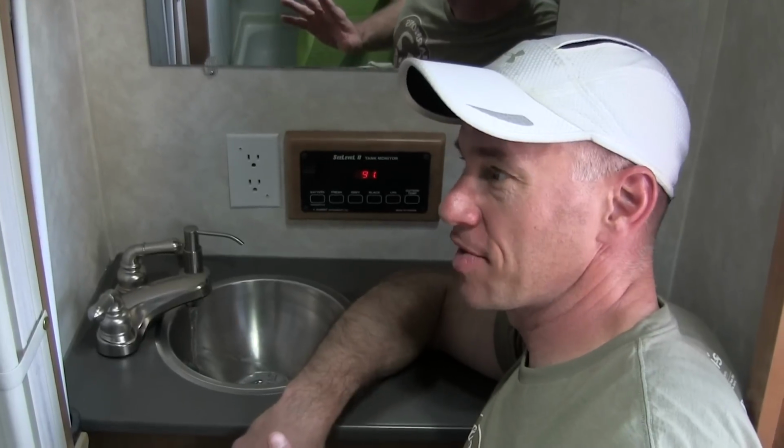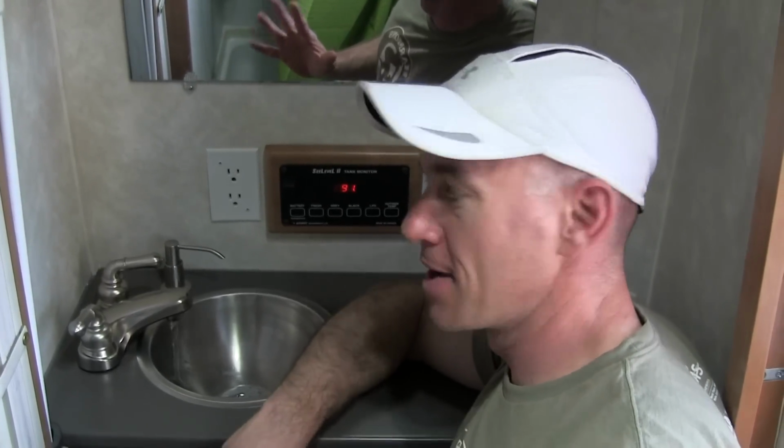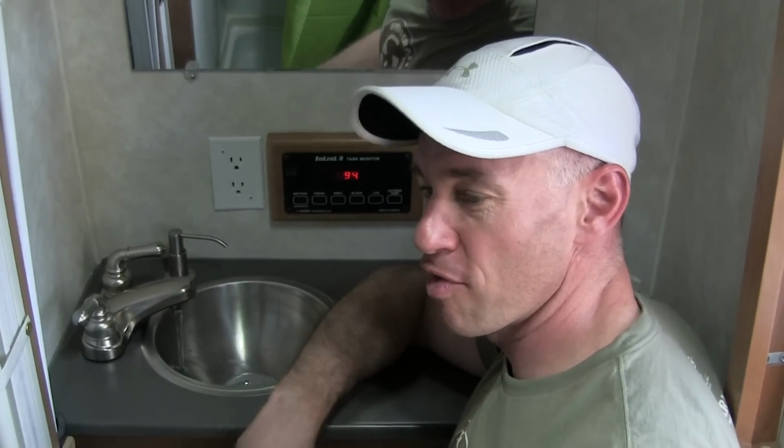But now I'm going to show you something that it only took me about 150 times of getting spewed all over before I figured it out. I'm going to leave this one faucet running when I go outside to shut off the water. That way when I unhook it from the side of the RV, it won't spew all over me because I'll have let the pressure out. So, we're done here. Back outside.